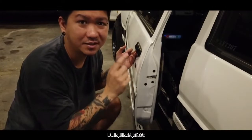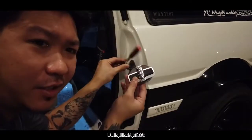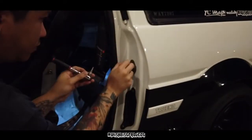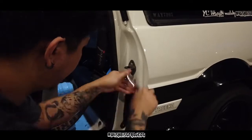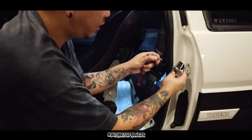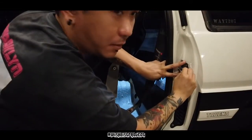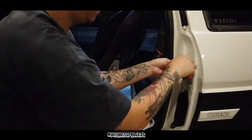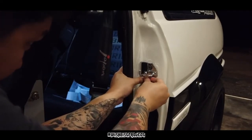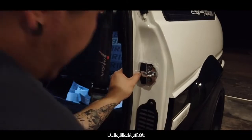So without wasting our time, let's just try to assemble it and see. It's very simple. Two bolts right here. As far as I know, this door stabilizer is not related to the door. You're going to open up this bolt, take out this bolt and another bolt, two bolts. Okay, there are no screws provided. You must use your own screws and then put it in like this. The spring loaded part must be facing inside. Not too tight first. You're going to put the other bolt in, and then just tighten with your hand, and then just pull this spring loaded part like this.